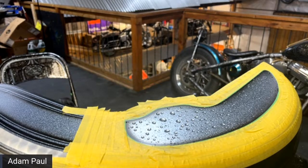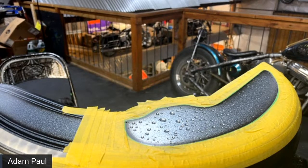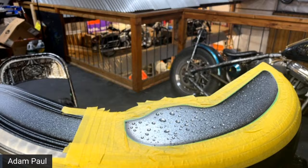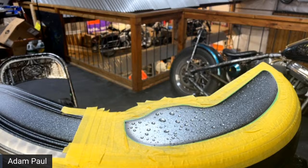Someone said, lacquer thinner does not mess with your things. In order to erase and redo an area, I thought it would melt it. Yeah, so I use lacquer thinner to erase a lot. But the key is it needs to be clear coated with regular clear coat if you're going to do that. It's a two-part mixture, part A, part B mixing together. It makes a hardened surface that should be resistant to lacquer thinner and other chemicals like gas and stuff like that.